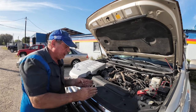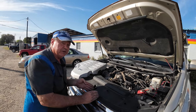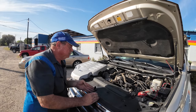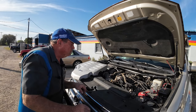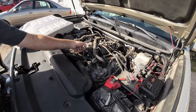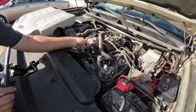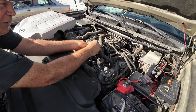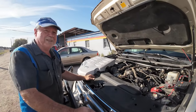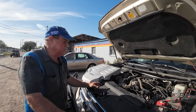You can imagine — plastic sitting down there for 10 years in the center of an engine running 300 degrees all the time. It's hot, and everything breaks. Toyota is notorious for their connectors wanting to break. This connector right here — if you aren't careful when you release it, you'd have to buy that connector, which is probably $75. You have to take a pick and carefully lift it up to get everything off, and every one of them is that way. That's where the DIYer would have problems if they get impatient.